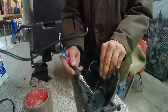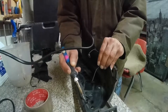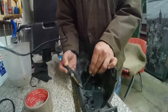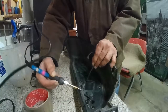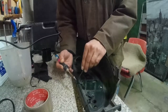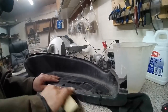I don't want to just keep melting cable ties to fill the missing section, but I'll go along the line and make sure it's welded down. The crack is maybe three inches long and went a further inch towards the footwell, and a big section came out as well. This is a footwell so a rubber pad will go back on top and it'll be hidden, but I still want it smooth, so I'm filling all the gaps and making sure it's secured on both sides.